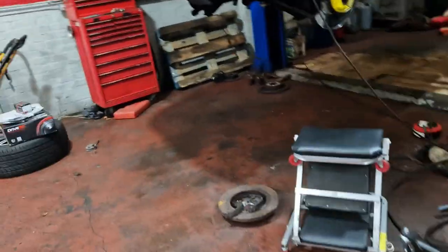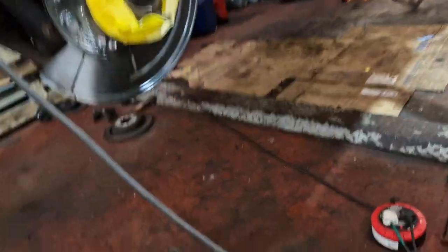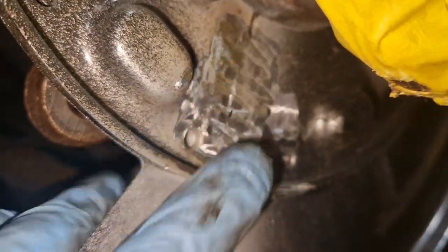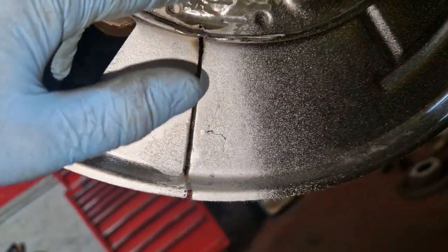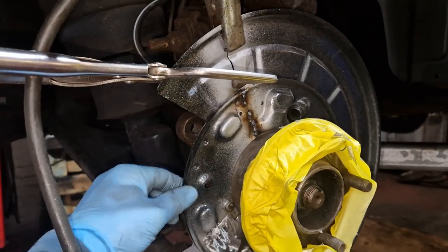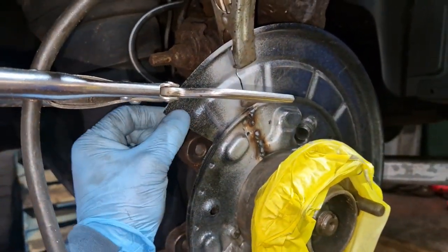So Land Rover, see I've already buffed my first load of welds down. You can just see there's a wee bit there, actually, that I'm a wee bit high on still. So I've buffed all this down, and I will weld up the wee bits that's missed, like I've done here. So I've already buffed this down and then re-welded the bits I've missed. It's like welding jewellery, doing a wee bit at a time so as to not warp it all to death.